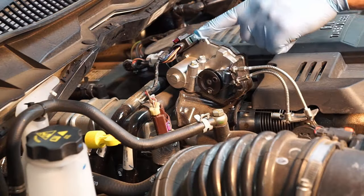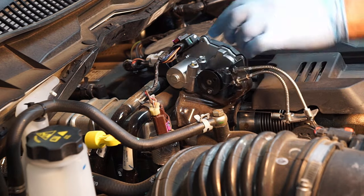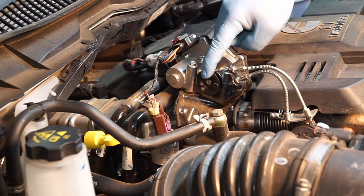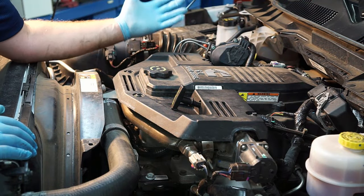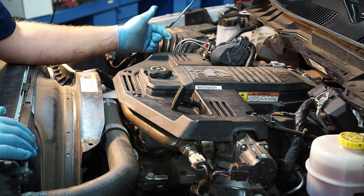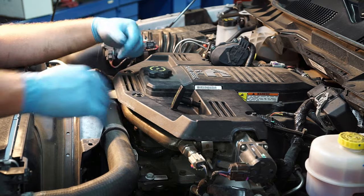On the side here we've got the EGR bypass solenoid and control assembly. A series of cables goes to a valve internally, and during events like a DPF regen, those extremely high exhaust gas temperatures are blocked from going through the EGR valve. It plugs off the EGR flow to help protect the intake system.